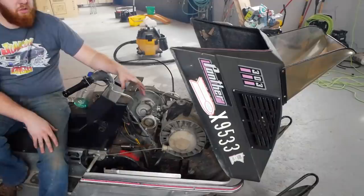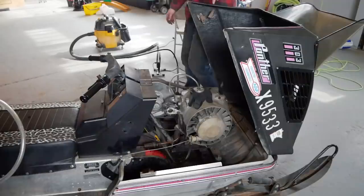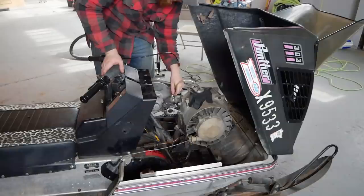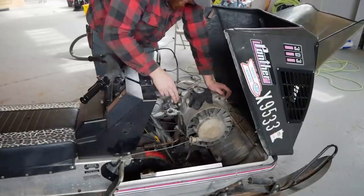Sounds not quite right, but I don't know what a rotary snowmobile is supposed to sound like. Okay, nothing's changed essentially, besides the fact that I took that velocity stack off so I can hopefully cover this better and see if we can eliminate the amount of air it gets, thusly enriching the amount of fuel it gets, because I'm tired of dealing with it and we're running out of options. So we're gonna throw some fuel at this again, see if we can choke this off and make it go, and hopefully burn the high effects off in 3 minutes and call it a video.